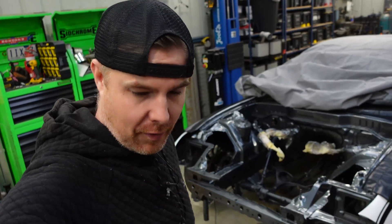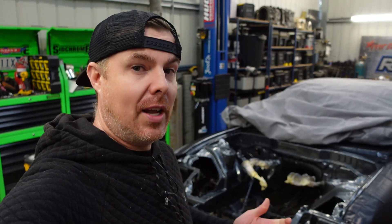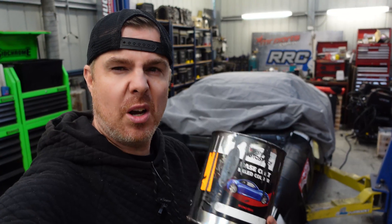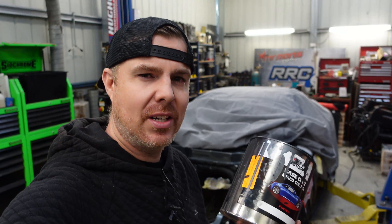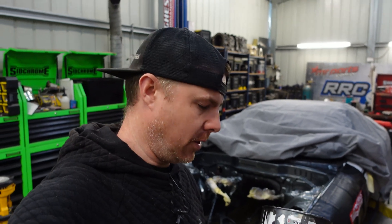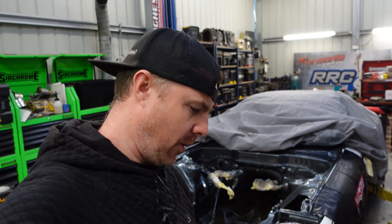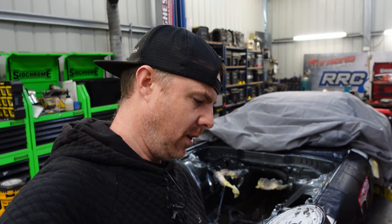This colour I've been asked about quite a few times since posting the engine bay colour. I don't actually have an answer — it's actually this motor spray, like a 1K sort of thing. You thin it down by about 80%, spray it on, and then while it's still wet you put your 2K clear with hardener in it and it all sets rock hard. But this colour just says mistint on it. What's funny is the colour on the lid doesn't really represent the colour once the paint hits the metal — it looks very silvery, almost like a silvery with a little bit of red through it, like a very pewter sort of silver.